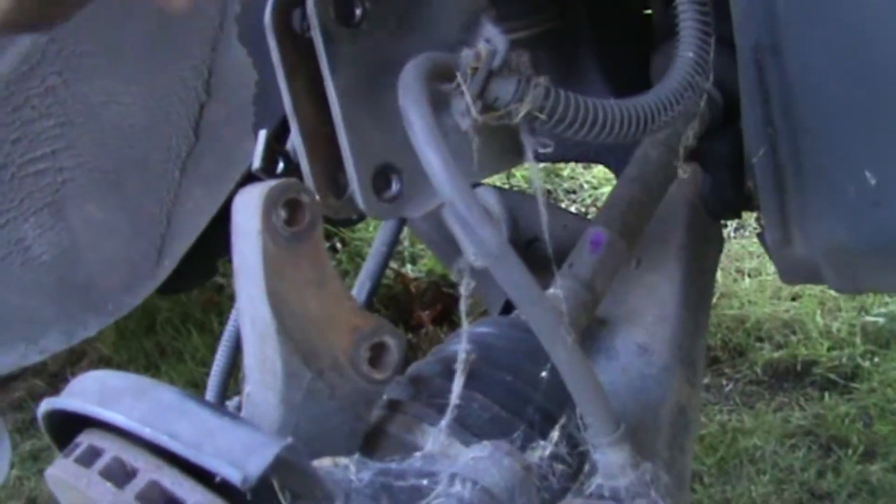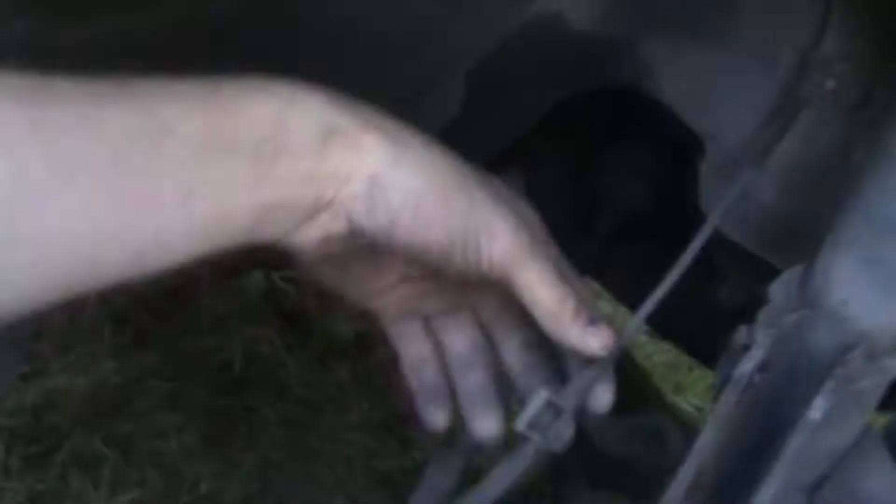Get the boss weld and just max it right out — put the heat into it. We're going to weld that in and she's going to be the duck's guts. Brake lines aren't really going to be an issue which is pretty good because we've got these big long boys — just whip that clip out of there and pull the brake line off, and we'll have a couple of inches of brake line each side. ABS is just long enough to cope.